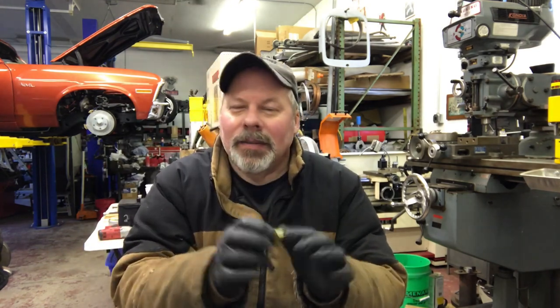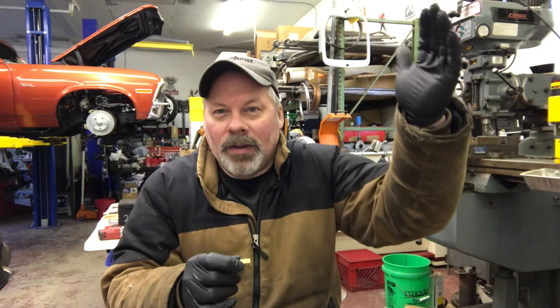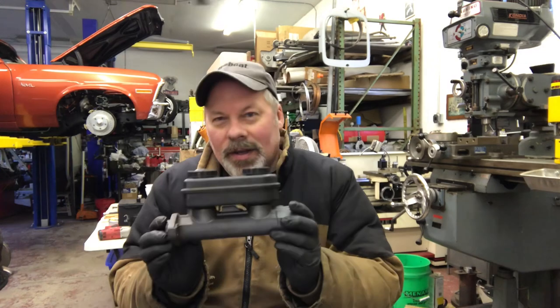At my fluid connection where the steel line meets the flexible line, I have an inverted plug and an inverted union. I'm going to close off the male line and break it right there over a bucket or a rag, instantly put this on here, and upstream is full. It's going to stay that way, and I'm free to do whatever I want at the wheel. The rear line on this car I've had capped for three summers. You could drive it like this if you tighten it up enough. You wouldn't have the function of whatever you plugged off, but there's no rush to worry about keeping this full and it's not drooling all over the floor. That's scenario number one when working downstream of the master cylinder.